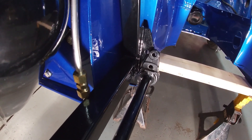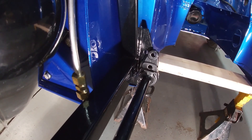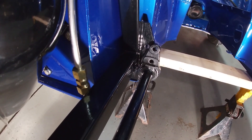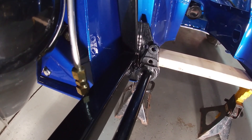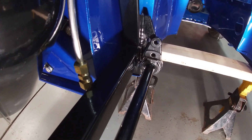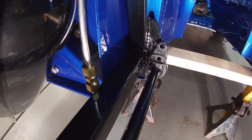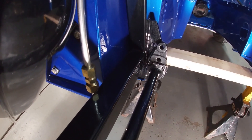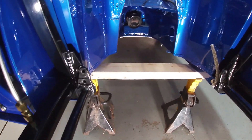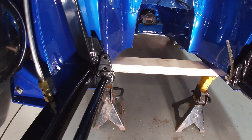The splines on the back and on the front have a different number — one is 24, the other end is 25 — and that gives you a vernier-type arrangement to get the most accurate position. I'm hoping I won't have to play with this too long to get that to line up, but I'm definitely going to set this per the gauge. The reason for doing this is to get the right ride height, and I've also bought an adjustable torque reaction plate which goes underneath the engine and connects this side to that side.